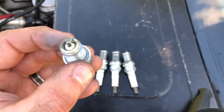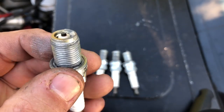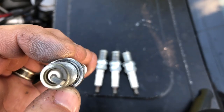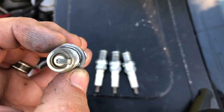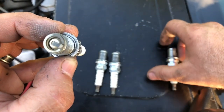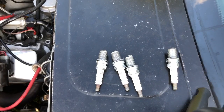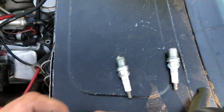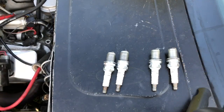Let's see how they're all looking. This is number five. That one right there is pretty doggone clear where the timing mark is - that's exactly like I like it. That timing mark right there is perfect. Now if you look at the fueling on that one though, the cadmium is burned off about a quarter, and you can go a half or a full turn and really not hurt anything. But generally from what I've seen, the car doesn't really pick up from running it leaner. So that hole, number five, we're going to add 1% of fuel. So number one and number three, I'm going to take out a degree of timing.